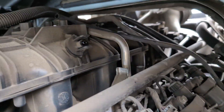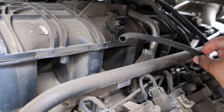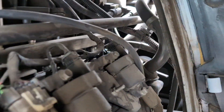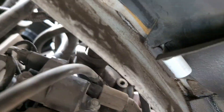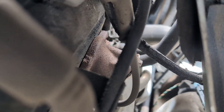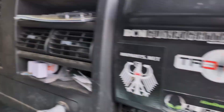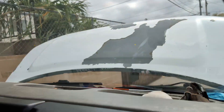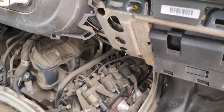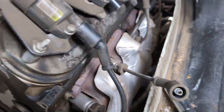The reason we're doing this job is because his AC controls weren't working. It's because this hose right here is broken — it's all dry-rotted. So he doesn't get any vacuum, and you can see right there how it's broken, probably from rubbing and age. When he tries to turn the AC on it just blows through the defrost setting only, because it's a vacuum control — you need that hose to be good.